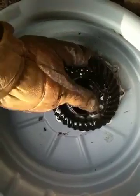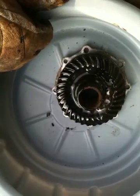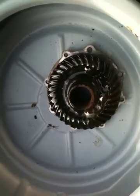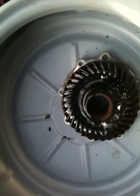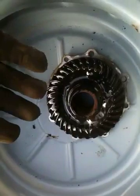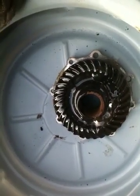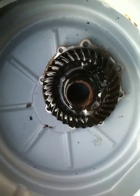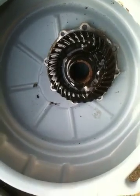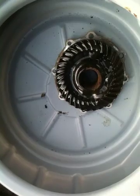He said something about maybe just wanting to weld the axle to the ring gear. It's not the best option, but he's going to get by kind of cheap. I think it's actually not going to be too bad of an idea just to try, because if the ring gear splines and the axle shaft splines are bad anyway, the only thing you're out if the weld breaks or doesn't hold up is just the ring gear and axle that you would have had to buy to begin with, and any labor to put it together. So we may end up trying that.